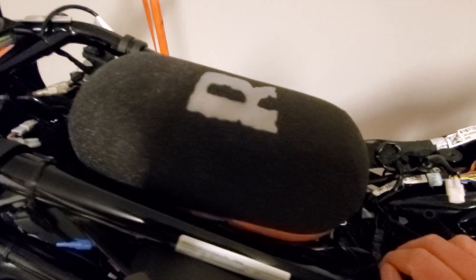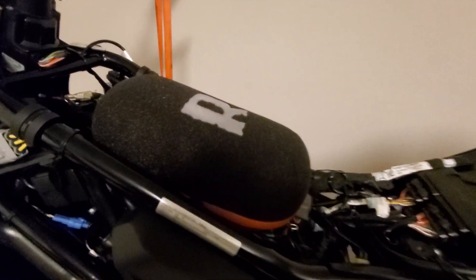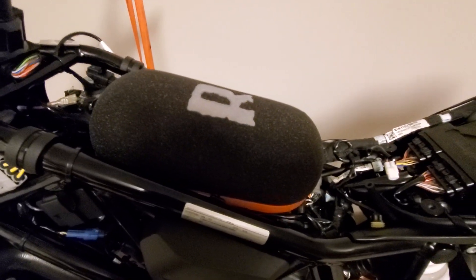The other mistake I made was I over-oiled the hell out of this filter. I put it all back together and noticed a bunch of air filter oil coming down on the rear cylinder, dripping down onto the lift. The instructions tell you to just saturate it from the outside, totally soak it — there are three layers of filter and it has to go through all three. Those are more of adventure bike instructions, from my understanding. So I went ahead and soaked off some of the oil with paper towels. It looks much better.